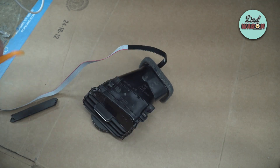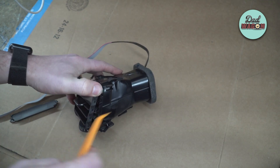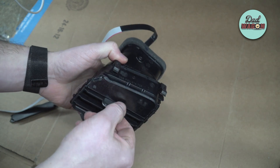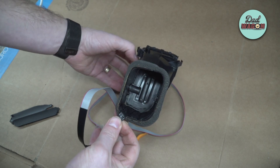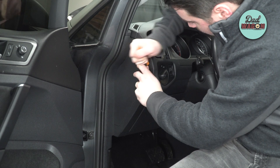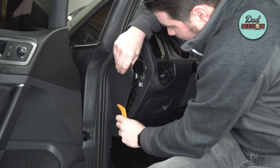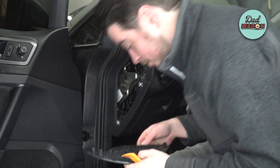Once you've ensured the alignment, snap it all the way back into place. I chose to use the trim removal tool to lift out the side frame a little to help push it back in. I'm just checking to make sure the on/off switch of the vent isn't being interfered with by the cable and that it's laying flat. Now grab the trim removal tool and remove the side cover of the dash by prying — there are three clips: one towards the top of the dash, one towards the driver, and one at the bottom.